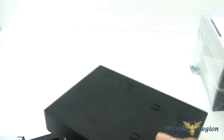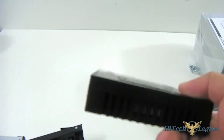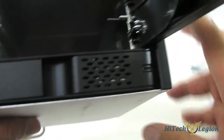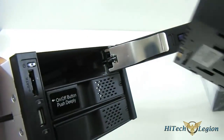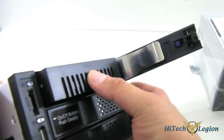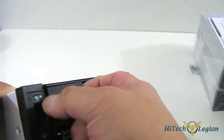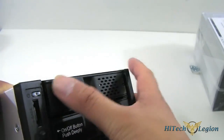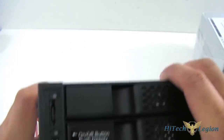You just open it completely so you can see each of the drive trays. I have one drive ready — I tested it earlier. I have the Icy Dock converter for a 2.5 inch SSD drive. You can use a 3.5 inch drive or a 2.5 inch converter with the Icy Dock Easy Convert. The trays lock very easily, so they are trayless. To install a drive, just push it in place — you'll hear essentially three clicks: one to put it in, one to lock it, and a third to secure it completely.